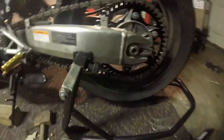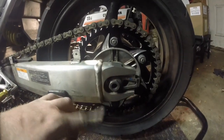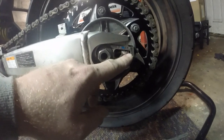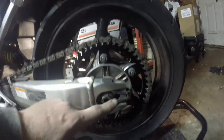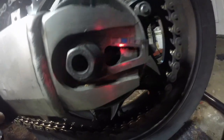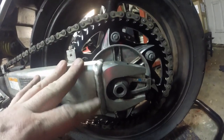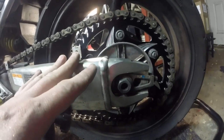All right, we figured out the brain fart. Before I added teeth, I could put my axle in and then just run my chain tensioner forward, then put the chain on and tighten it. I can't do that now because this is at maximum dropout, and I kept thinking my chain was too short. I was very mad. I did the research. 108 links was supposed to work.